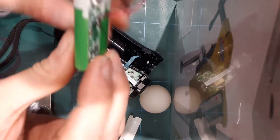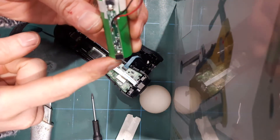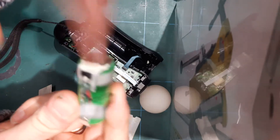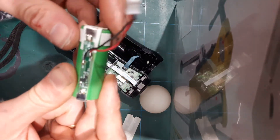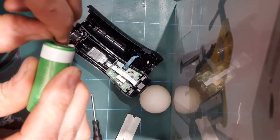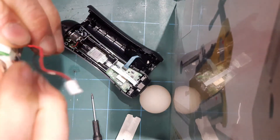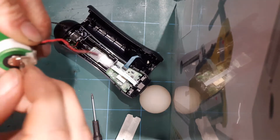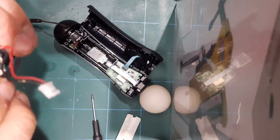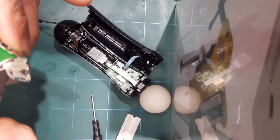So there's the old battery cell. What we want to do now is carefully prise off this end cap and this end cap, noting which one is positive — the positive one is nearest the red wire — so we get it the right way around when we put the new battery in. I'm just going to prise these off; they are quite awkward and you think they're going to snap or bend, but they won't.